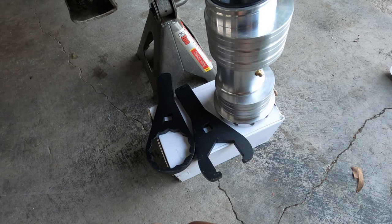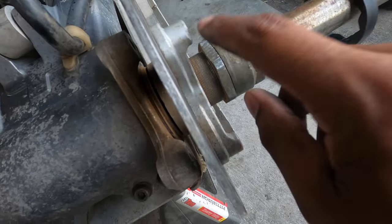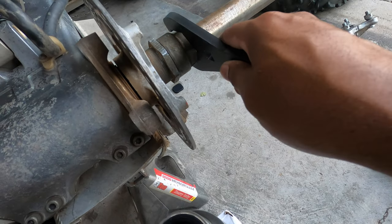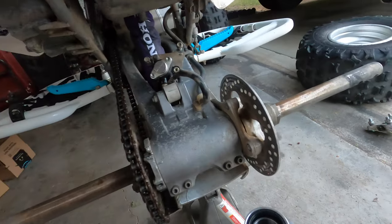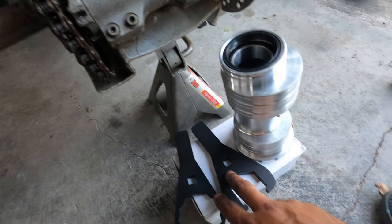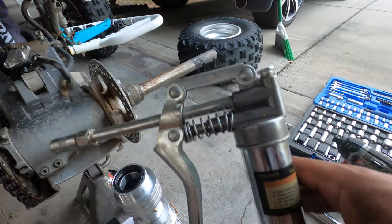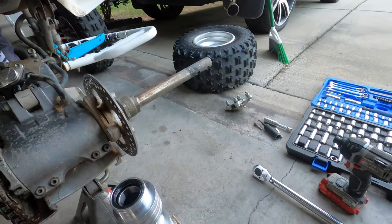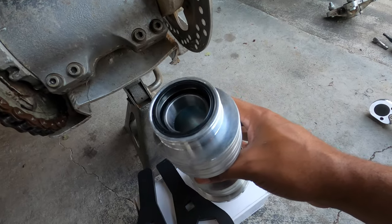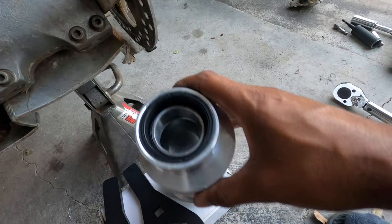What you see here are the tools to remove the carrier. You have the big wrench which slips over the axle and grips onto the inner nut, and then you have the open end which goes on to the outer nut. I will have the link in the description because I got all of this off Amazon — this was like $45 and these were like $44. You will also need a grease gun; the carrier probably comes with no grease so you'll need to grease it up, and you can also use the grease on the outside of the cam.